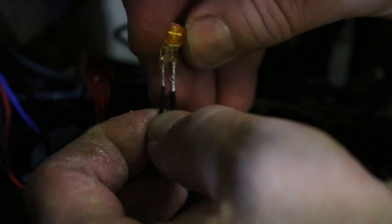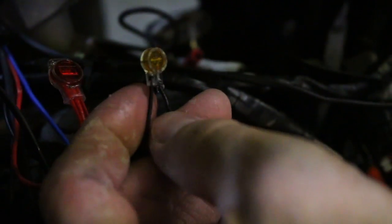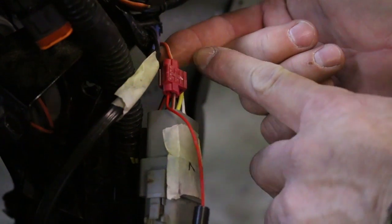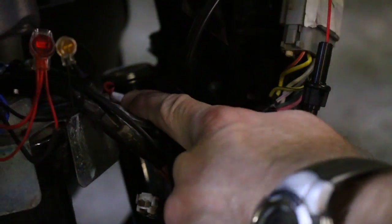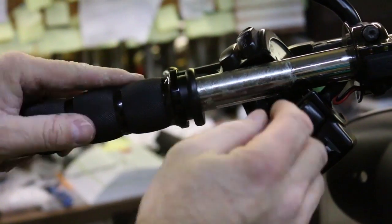Now, using the 2-hole connector, connect the power wire black to black controller wire. Finally, using another 3-hole connector, connect the red jumper wire to the 2 red wires from the grip heaters. After they are all connected, start connecting the wires to the power source. Connect the red power supply wire to an accessory circuit, typically an orange and white striped wire under the gas tank in the harness. Leave the inline fuse as accessible as possible during this step.